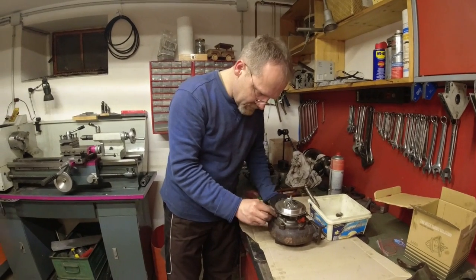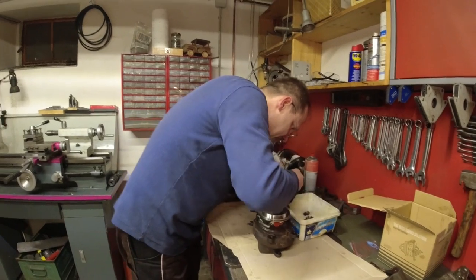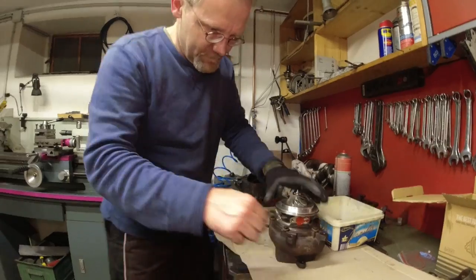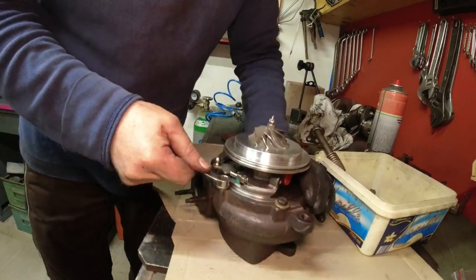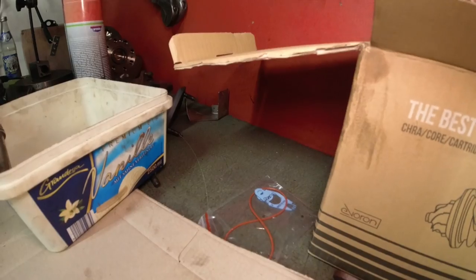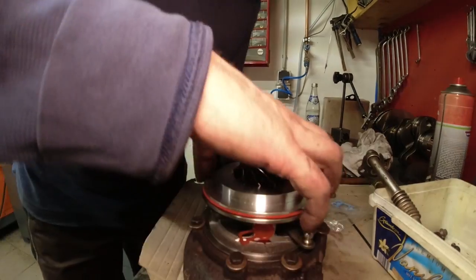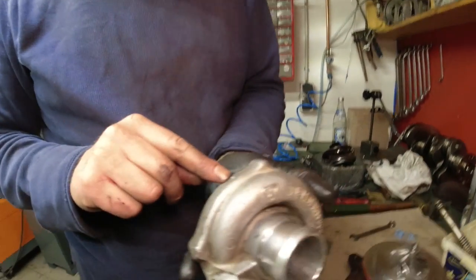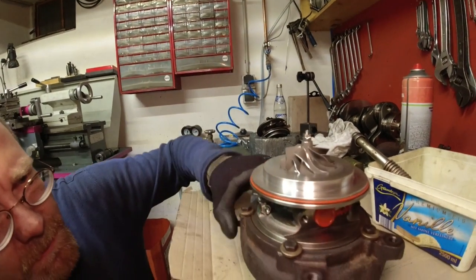I can't make a video like this — it's too boring. Well, who cares? It's the most important work. It's the most annoying work. We tighten them up and that's it. They are tight. Now the next thing is this gasket — got to go on here. I put a mark on here when I took it apart. See, there are three dots, and these three dots have to line up with three dots I put on here.